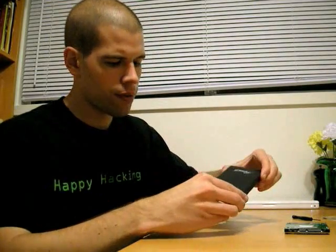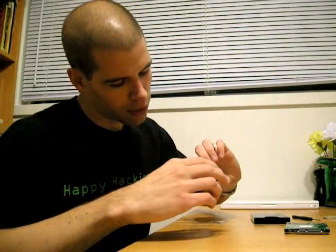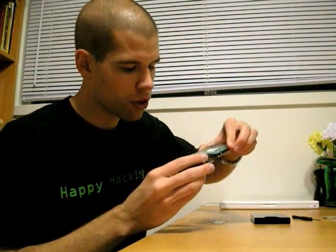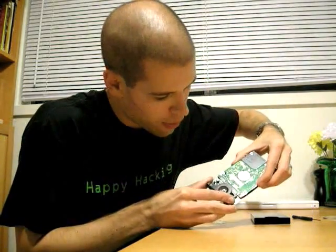The first step is to install this hard drive — now unpackaged and ready — into the enclosure. We've got a screwdriver and screws for the installation. First, we open the enclosure and take off the warning label that says the hard drive must be formatted. This enclosure doesn't require any screws to install the hard drive; it just fits into the controller board. So we slide it in, and the hard drive is now attached to the controller.